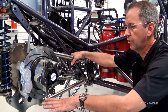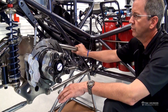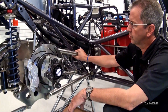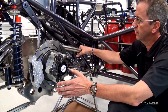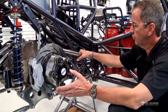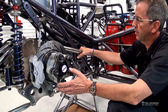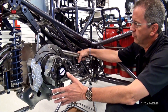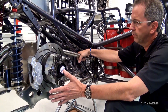If you had this car sitting on scales with tires on top of the digital scales and you were turning this bar, you would see the weight change. Preload adjustment is just one of the many settings used in the four link assembly to help the car work properly.